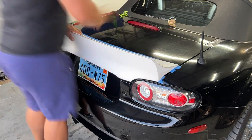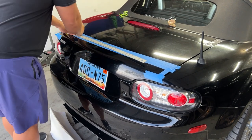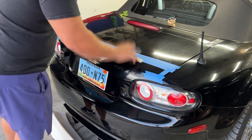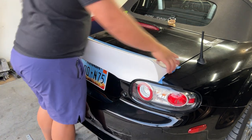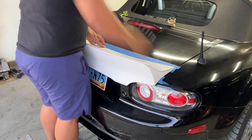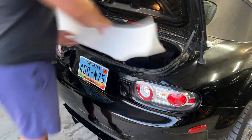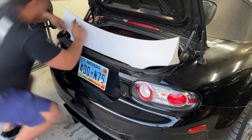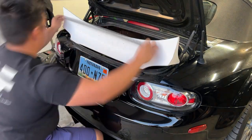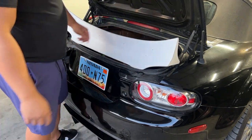Let's go mark this out. When you get to the point of mounting the spoiler, you want to be very precise with your measurements - measure many times and drill once. My technique is to measure out the holes and transfer that onto the duck bill. If you're not tracking these cars, I highly recommend you just double-sided tape it to your trunk with 3M ultra strong double-sided tape. It's a lot easier and will save you a lot of time. You can also just skip to the end of this video to see the final result.